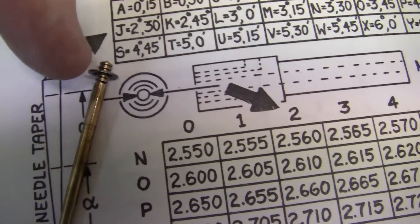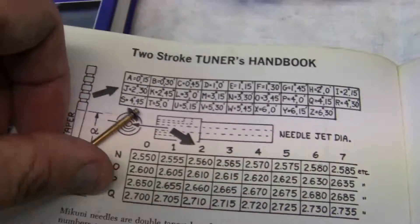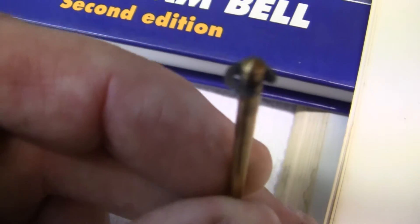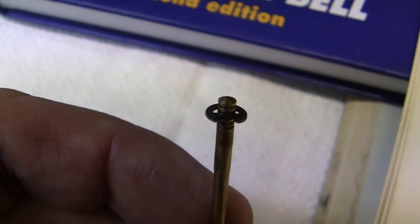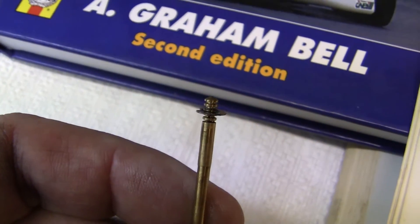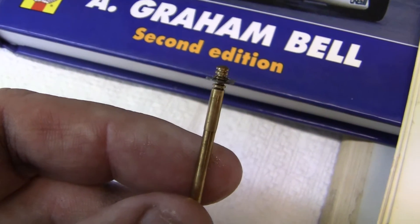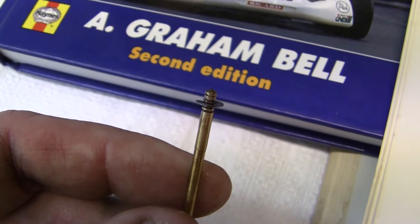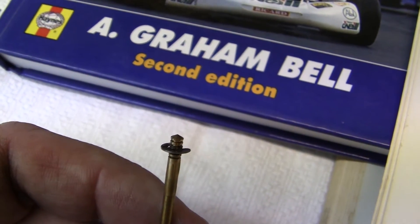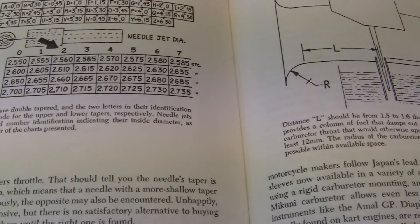There are only three on this one, but on all major new carburetors they have five. This c-clamp is able to be pulled off with a set of pliers. If you put this clip one slot lower, you'll raise the needle valve and it will allow more fuel to enter the circuit as you're pulling your throttle. If you put the clip one higher, the needle valve will be a little bit lower and will allow less fuel. Remember, we're trying to do adjustments — that's the deal here. It's all about adjustments.